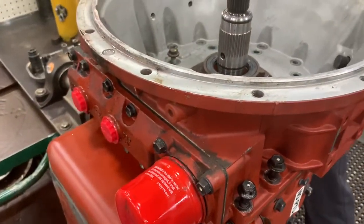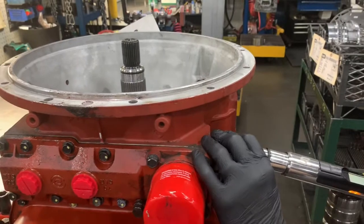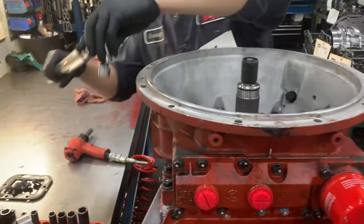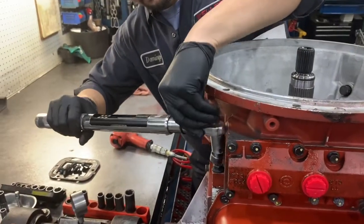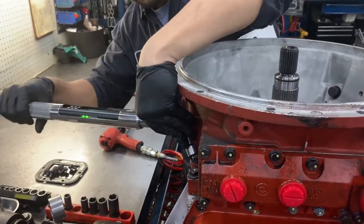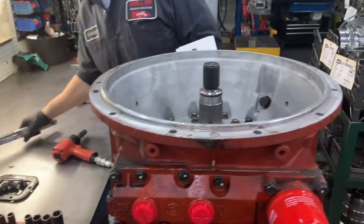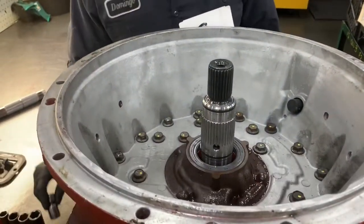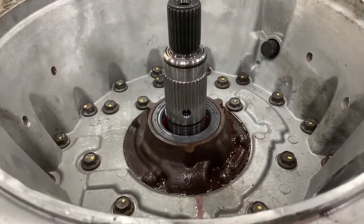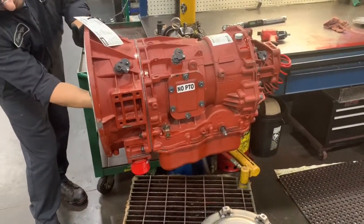Make sure to use a torque wrench. Take your torque wrench and go through all the bolts. You can mark them with a paint marker for all the ones you've done already. Torque all of them down to 38 to 45 foot-pounds to spec — they've got to be pretty accurate. Make a little yellow paint dot on top of each bolt after you've torqued it. Then we're going to put the converter on.